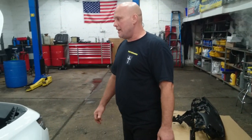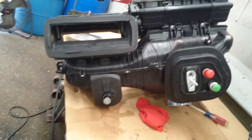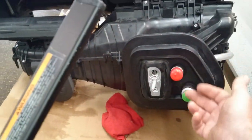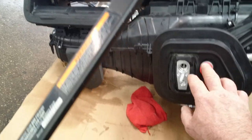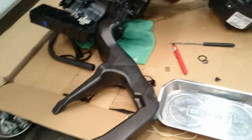This is a difficult job. Now we're back — I just want to show you what it looks like after it's all put back together. The heater core is the one over here with the two separate lines. I would suggest you cap these and cover them up because if you don't, you're going to leak coolant on the inside of the vehicle. For the most part it is all one piece.